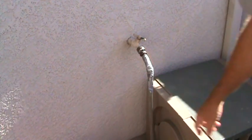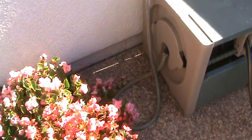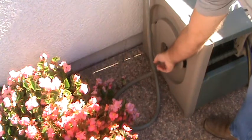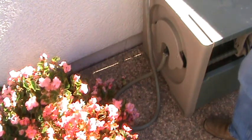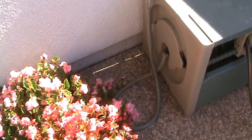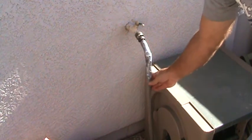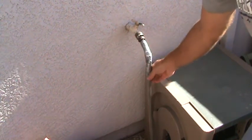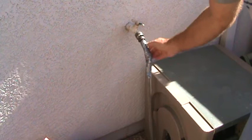You could get a hose and replace this whole piece if you wanted — you'd have to undo this here to get a whole new hose section up, maybe just a short piece. But instead of that, I've decided to cut this off, since I think it's still flexible enough, and then put a new hose piece on the very end with a screw-on fitting.